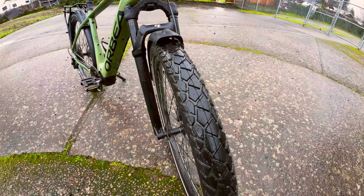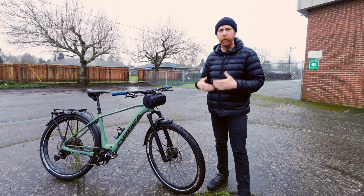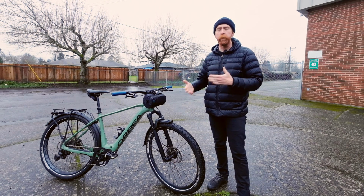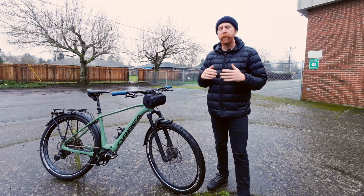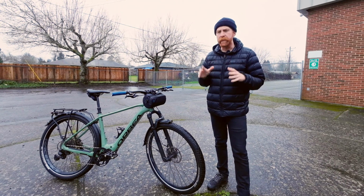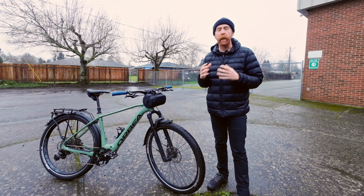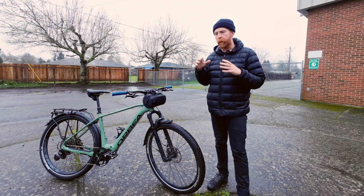These Allgrounders, with that pad in the center, offset with a tighter gap in between them, is gonna have better traction on the pavement. It's gonna have better rolling resistance. So it's gonna roll more efficiently, smoother, optimize the battery, optimize your range, help you keep speed better, and equally help with stopping better. And this is a key detail in tread design, and where tread design really has an impact that a lot of people overlook.